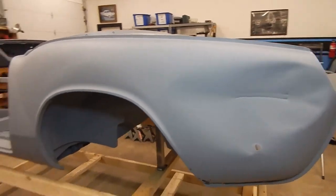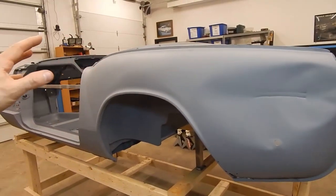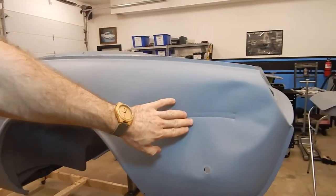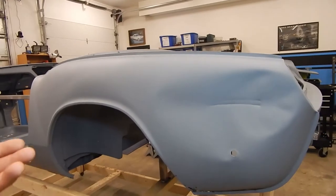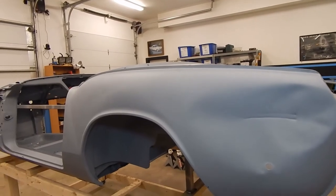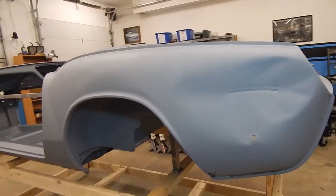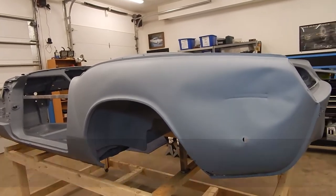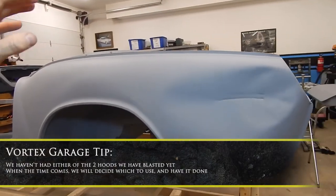Let's take a look at the driver's rear quarter panel to start. What we're going to find on this car is a lot of positive news and a lot of things that obviously need repair. There's a pretty nasty dent in here, and this is nothing new — this is what we saw before. The nice thing about taking it down to media blast was being able to see the backside of every panel and confirm that this car did not have any Bondo on it. The hood, if you remember, does have some Bondo — that's the one area where someone started restoration work — but the rest of the body was largely untouched. So it's a pretty honest car.